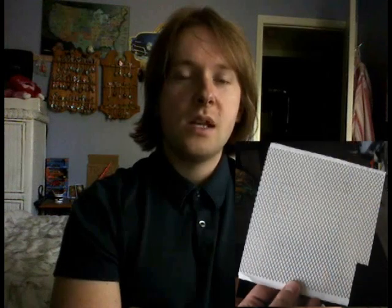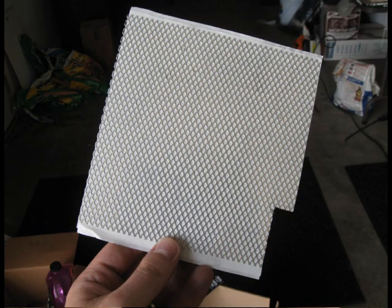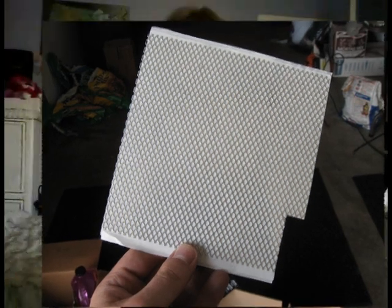This is a self-adhesive metal patch sheet. I will cut off the right piece of it that will fit right into the hole that I'm trying to cover. I will also make sure that it's pushed in a little bit so it's below the surface. This will prepare the area for the body filler.